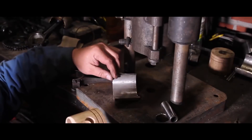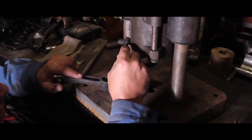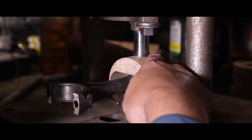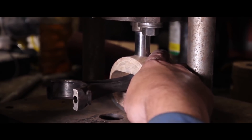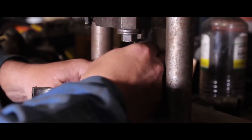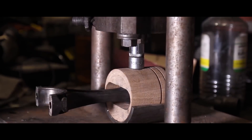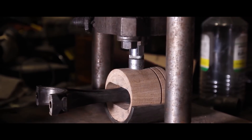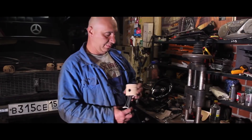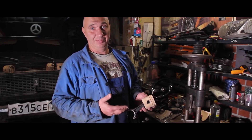Here we have our piston and a special half sleeve so that the piston doesn't crack. Now we take our pin and carefully use our press to get it inside. It's a tight fit, but it is what it is. We won't be able to use our press to insert the pin all the way, so we'll be using this socket. That's how things go down in the garage — this ain't a repair shop. There we go, this should do the job. The rod seems to be moving without any restriction. Now we'll give the rest of them the same treatment.